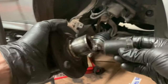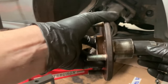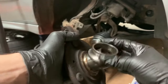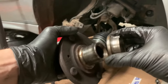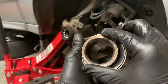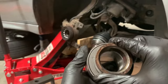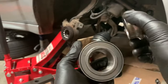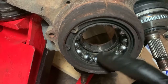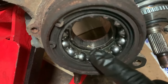What I really couldn't show you back there was this threaded nut goes right on that part, and then as it tightens it just pulled that hub out. Then this inner race was on — pull that off, and what you're looking at is that inner race of the bearing. That's why you have to pull just the hub out — you can't pull this inner race off because there's still half of it on the other side. You can see it still moves, but that grease is just dried peanut butter and it's not good.